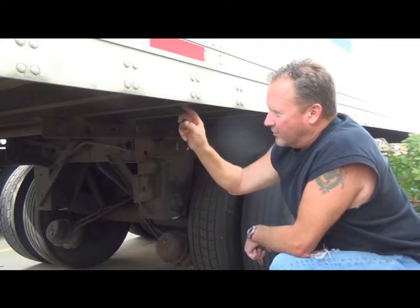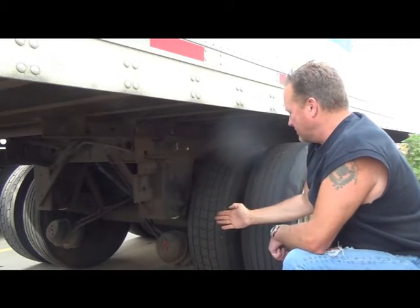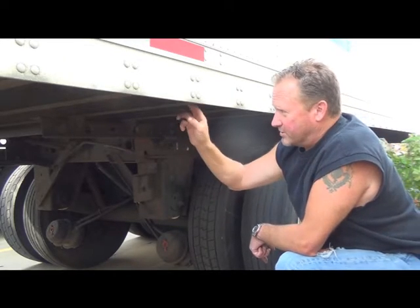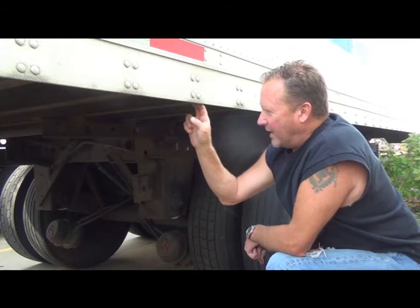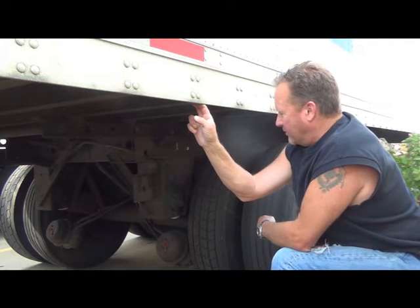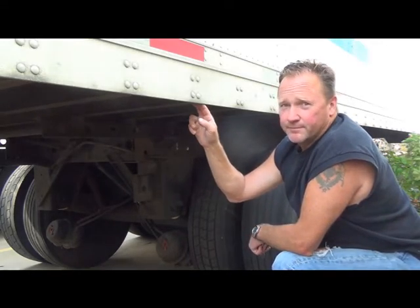In this case, this I-beam right next to the stop will give sufficient clearance if the tandems are in the most forward position. So now that we've established the very first I-beam that's clear of the tandem wheels when they're all the way forward, this is your start point.